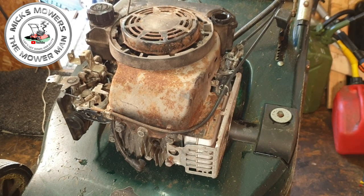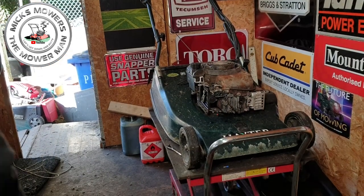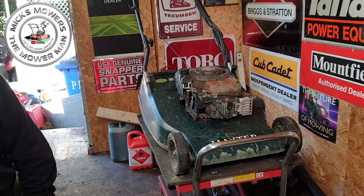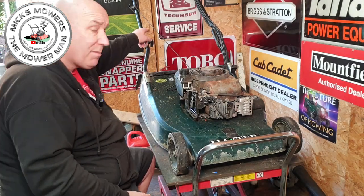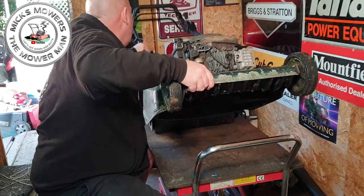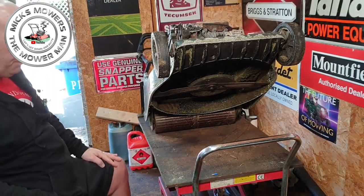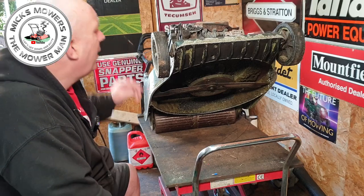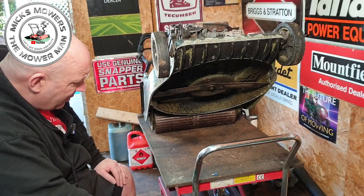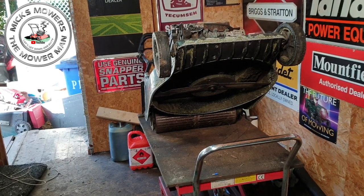Now that there's no oil in the machine, I want to tip it up onto its back — what I call the CPR position. I've got a little tiny screw at the end of my wall, put there on purpose. Tip the machine up and hook it onto that screw — it'll sit there happy as Larry. HT lead has been removed and the spark plug has been taken out too. There's a 14mm bolt underneath here which we now need to remove to get the blade off. I'll grab my half-inch impact.